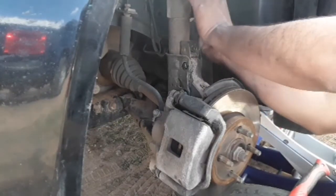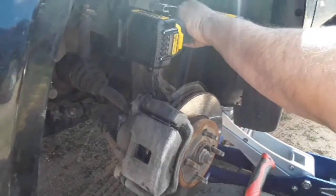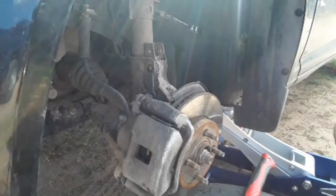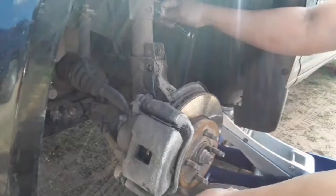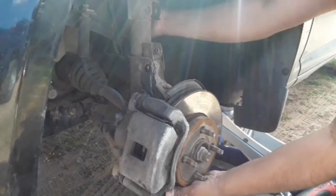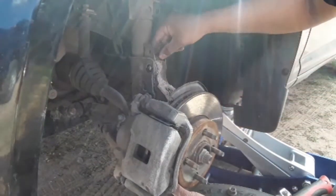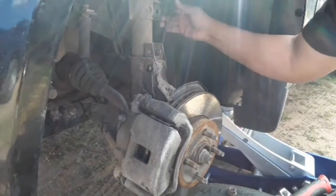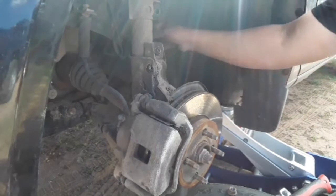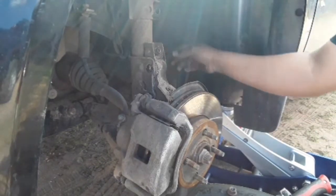Got it — there's a little nut in there. There we go, got it out. And then this one — just lift up a little bit. There you go. This is your sway bar. Now it's getting loose. You can inspect this link too — make sure it's good because that's your steering. I have to replace mine later, so I'll make a video on that one.